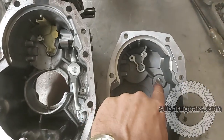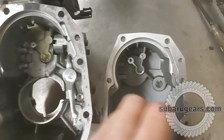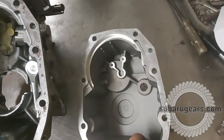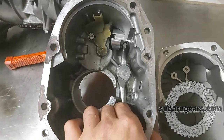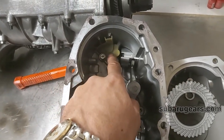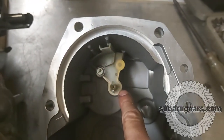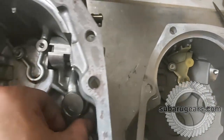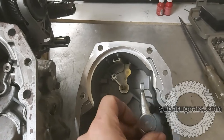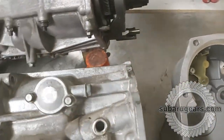The only other removable part here is this horseshoe — flat towards the outside — which keeps the input shaft in place. Now we have the center differential housing removed. It has the shift rod in it and there are a couple of mechanisms we need to transfer over to the supernose. The supernose casting has a hole for the shift rod, a machined and drilled and tapped area for the oil slinger, and a machined area on the side for the reverse lockout and the two electric sensors. The oil slinger is now fitted to the supernose — it catches any oil, feeds it down and up into the main shaft, which is important for lubricating the bearings. We checked the shifter fits the supernose — slides in easily, turns no problem.